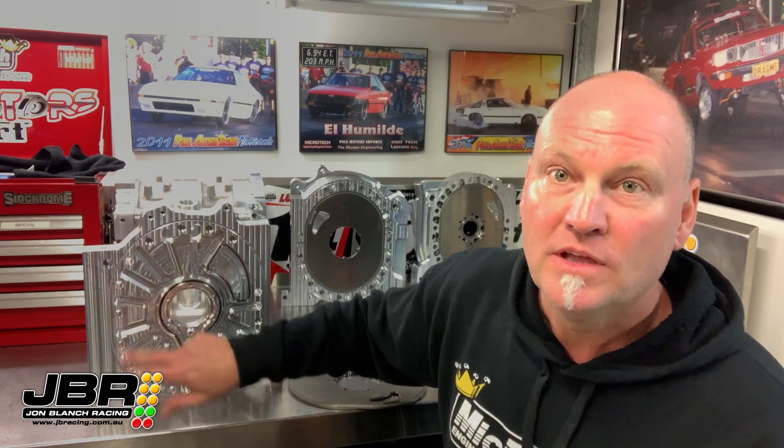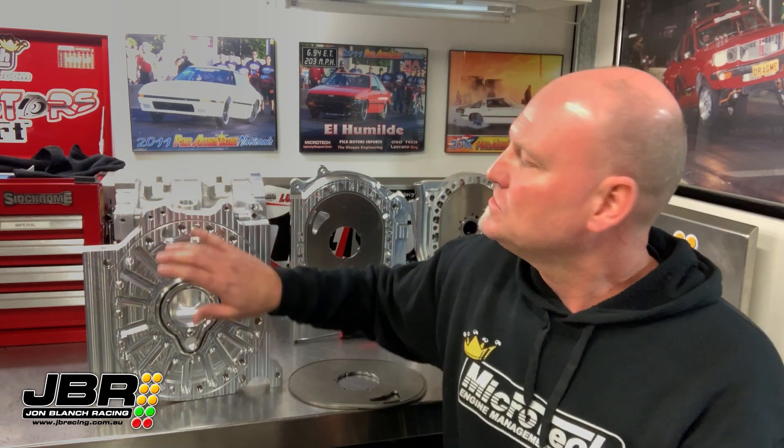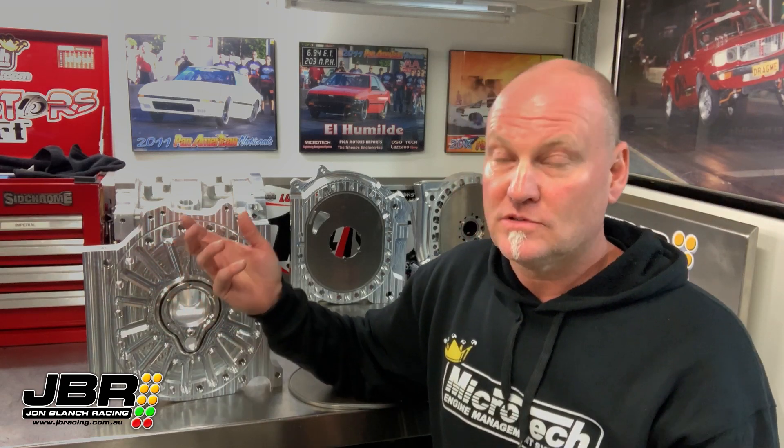A big advantage from that is thermal expansion of the plate is kept to a bare minimum, and any expansion that does occur is relatively consistent all the way through the engine. When metal expands it moves, and in a rotary engine if the plates and housings move around it screws up the alignment of the engine. If this part of the plate gets way hotter than this part out here, the plate itself is going to warp — and even a couple of thou over the length of the engine can turn into 10–15 thou by the time you get to the other end. If you've spent time building rotary engines you'll know how important it is for the bore and the front and rear stationary gears to be perfectly in line. If the engine isn't perfectly straight, you're more than likely going to tear the bearings out of it, usually by the time you get half track.